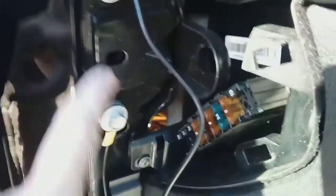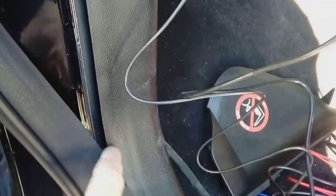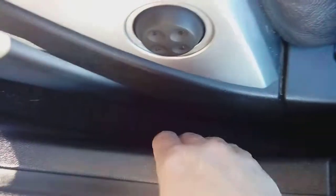Pull the rubber door seal off and run the red power cable — which will need extending, so you'll need some additional red power cable. Cameras only have a 2-amp fuse and normally only use about 300 milliamps, so it doesn't need to be heavy-duty cable. Run it down and then under the sill plate all the way along until you get to the boot. Tuck it under neatly so nobody trips on it.